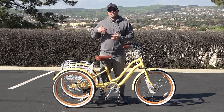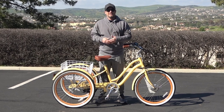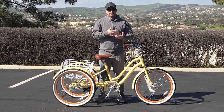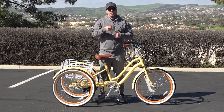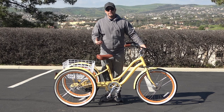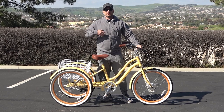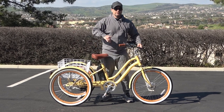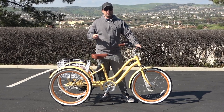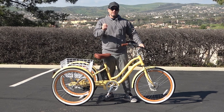The configuration of the front cog and rear chain wheel sets the resistance and dictates how easy or hard it is to pedal, and how fast you can get the tricycle going. Typically, the harder it is to pedal, the faster it will allow you to go as you build up momentum. The easier it is to pedal, you're going to be pedaling faster but going slower. First gear is usually easier to pedal and ideal for hills. Higher gears are harder to pedal but allow the bike to go faster. With a single speed, you're relying on the manufacturer to find that one gear that's best for you.